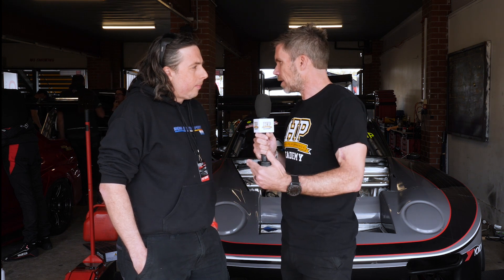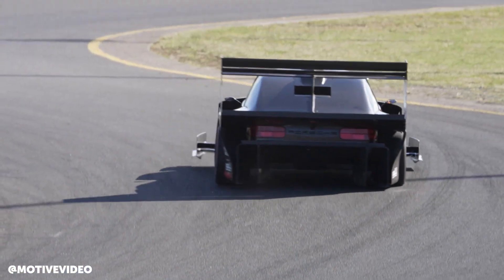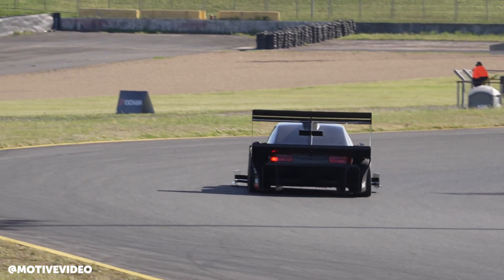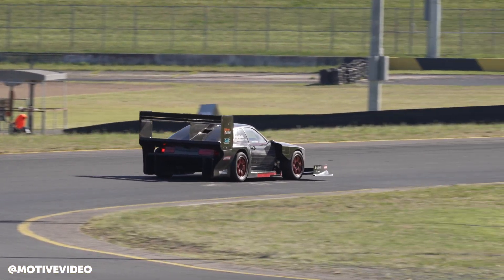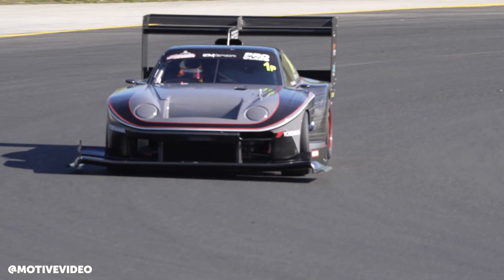At the moment, with the lack of brake torque on the front axle and the inability to lock the front in higher-speed areas, we're giving away braking performance. It's hard to put exact numbers on it, but we're hoping that if we can clamp the wheel enough to lock it early in the braking phase, we should see another 0.2 or 0.3G hopefully. These are just estimates, but we're not seeing the maximum at the moment so we'll take any improvement we can get.